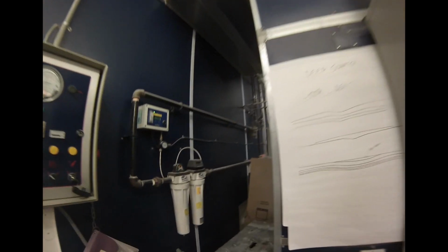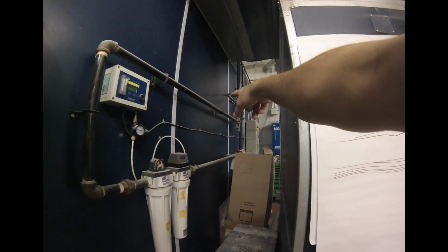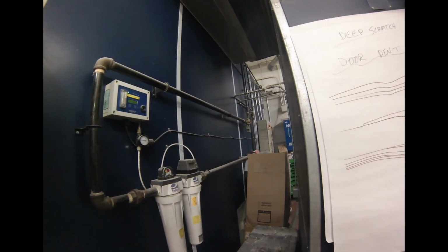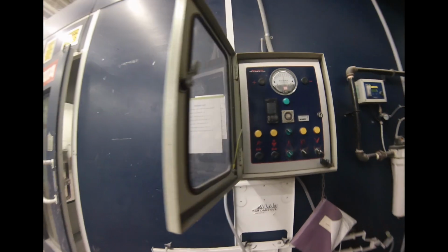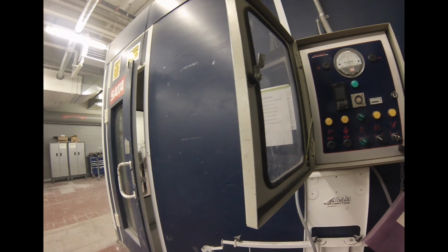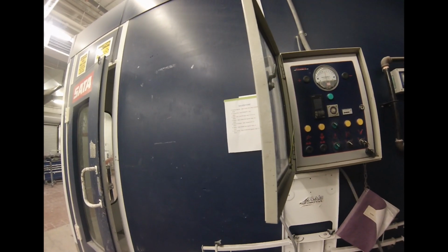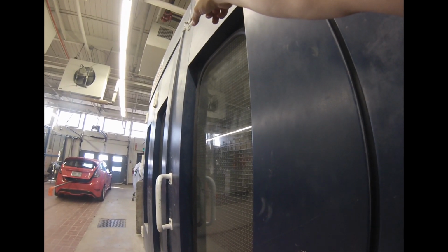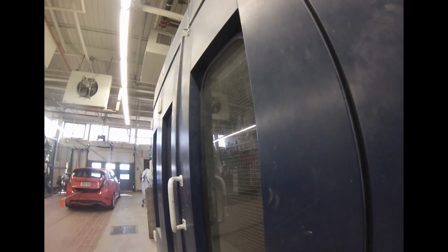And there's a little air interlock switch right there on the back that's electronic. It shuts off the air for this pipe that goes into the booth here, right? So you don't get any air, right? So ours is leaking, so it actually needs to be adjusted. I've adjusted it a bunch of times. I built a little bracket a couple of times too. And because the top of the door there's just thin sheet metal, it keeps getting looser and looser all the time, right? Another instructor here made a really fancy one for the other door that's adjustable. And I got to make one like that for the other side. You can see it's got like a little nut, and you can adjust it in and out. You can see it's actually bending the door, right? But that one doesn't leak, so I'm gonna make one like that for it, right?